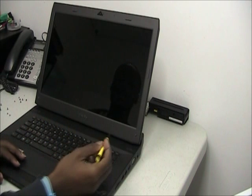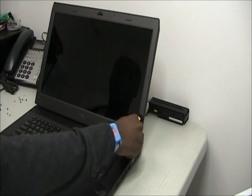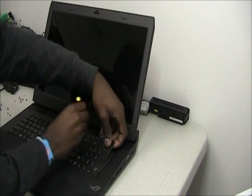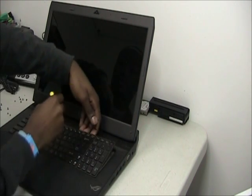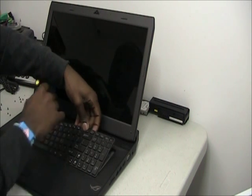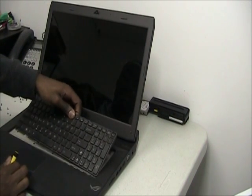Take the flat screwdriver, there are notches here — just pull up. Next, the rest, just push them in. And the keyboard slides out like so.